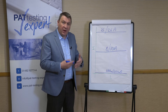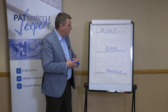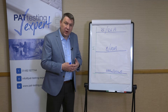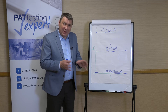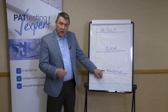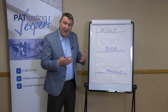If we wanted to get an accurate reading and find out how well the earth was connected — whether it was connected well enough to save us in the event of a fault — then we'd have to use a high current test. Fast forward 20–25 years, and PAT tester manufacturers have got a lot better at designing machines. The technology has increased and nowadays this low current setting is a lot more accurate than it used to be — pretty much accurate enough to be used on everything.